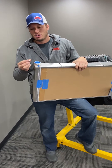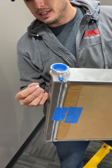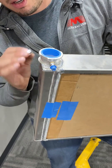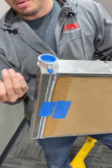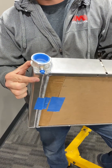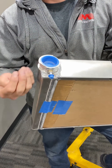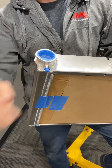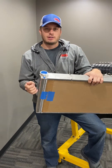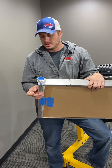What we suggest is to get yourself a 1/8-inch NPT weld bung — we sell them and they're cheap — and weld it into any of the sides or top of the tank, right below the radiator cap. All of that steam pressure and air is going to sit in a pocket right there. There's usually dead space there anyway, and as pressure builds it's going to push the cap up and relieve out of the system as intended. That's how the factory designed it, and that's what we suggest for best results.